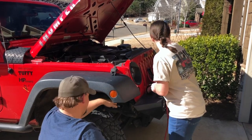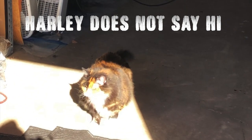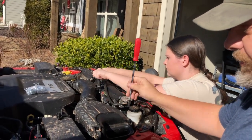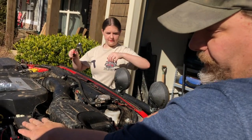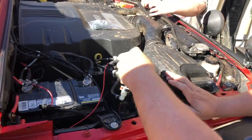Oh, now we have a pretty path. Hello Harley, how are you breathing? So what we're gonna do is pull the air box out so we have plenty of room. We're gonna run those cables up — either under or around the air box — around the fuse panel here, and then try to get in between here and hook up to the battery.